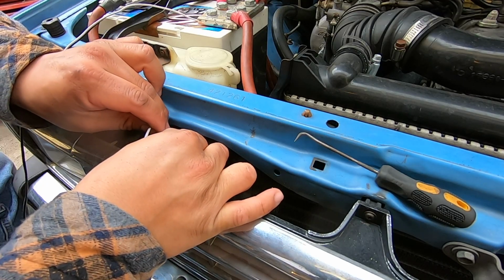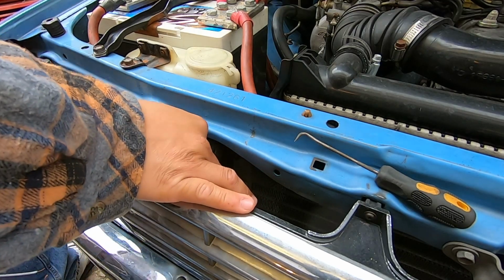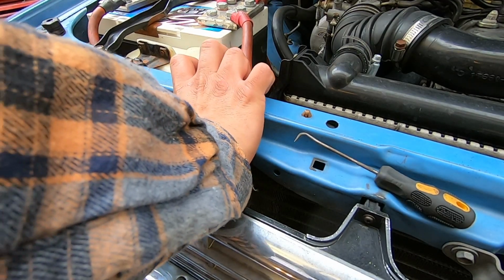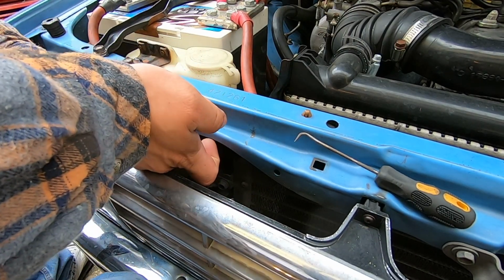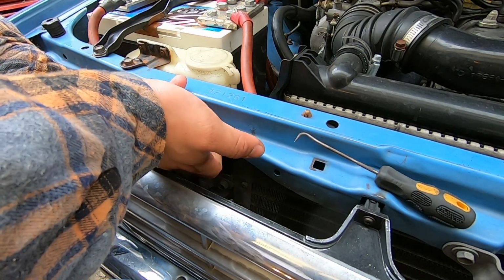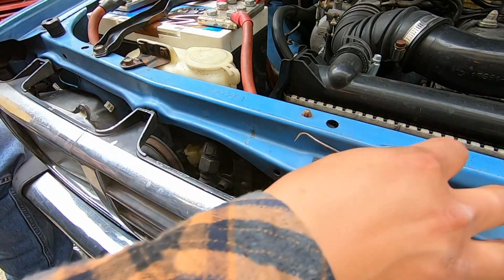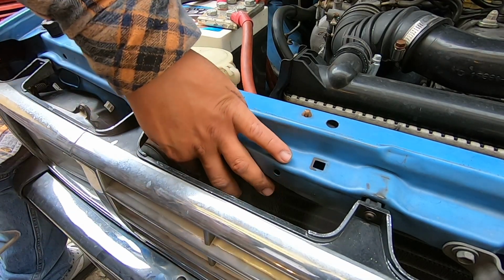It does work. Okay, so the horn actually works. Now the thing is that the power isn't getting to the horn, and we did some research, and we actually found out that there's like a little pin behind the steering wheel that makes the contact for the horn, and it gets worn, so you're no longer able to use the horn once that thing is gone.